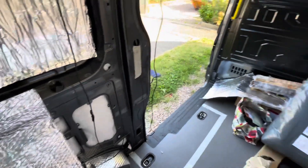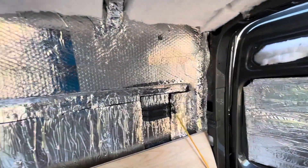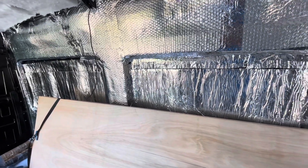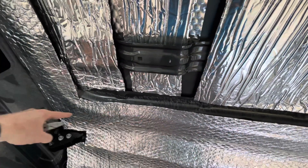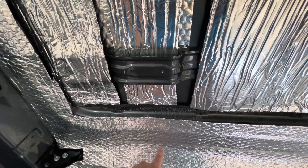Just got this last bit to do here, and we've already done all over that side, all down the window recesses and into the corners. That's just going to add a nice vapour barrier and keep all that Dodo thermo fleece liner intact. We're coming up to 71cm at that height, to come around that little bracket, up across and up — because there is a little dogleg in the wall around here. As you can see, it comes along and then kicks back, so I don't want to be bending the ply to sit along and up.